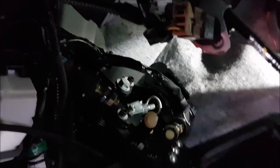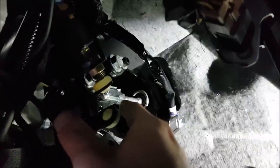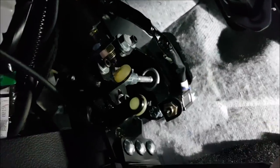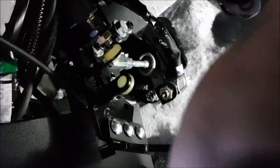We're all done now, and you want to make sure all the switches work properly. We have our stop adjusted down here and we've finalized tightening that. One of the biggest things you want to make sure when installing this pedal — because everything's so adjustable — is that when you're pushing in that rod on the master cylinder, it goes in straight. You can adjust this quite a bit where it goes cockeyed at an angle, and if it feels really nice and stiff, you're going to wreck your master cylinder.